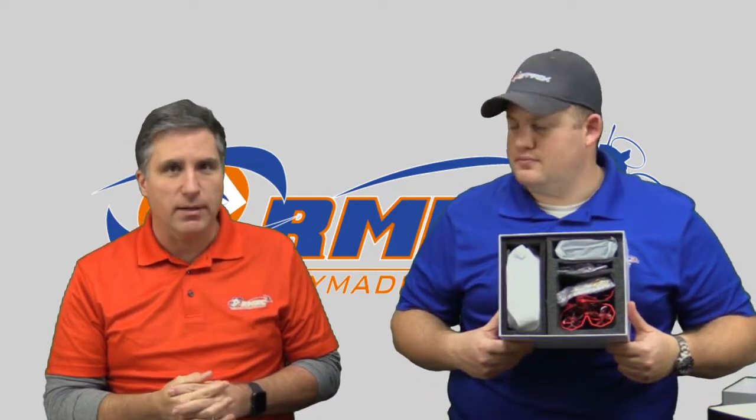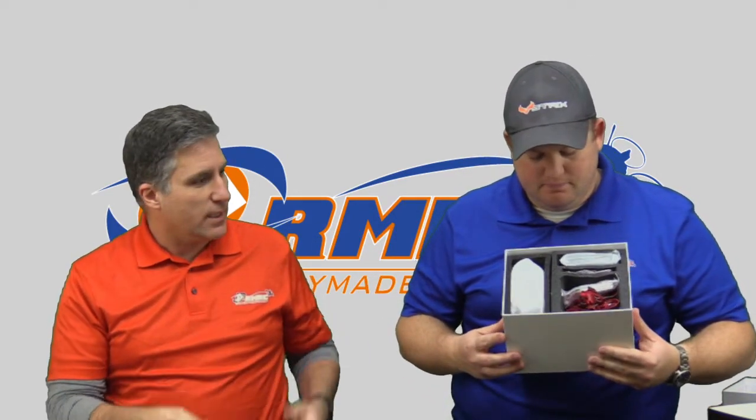Kevin is opening the box. I'm going to throw out some stats so we don't drag on the video too long. It's a Junior Racer 75 — that's the frame that comes with it — with an F4, 12-amp all-in-one flight controller, 1103 8,000 KV motors. It runs on 3S and comes with a 3S 300 milliamp hour battery, which you can see right on top of the package.